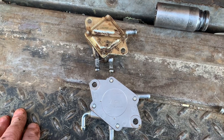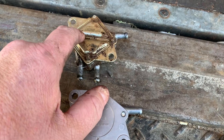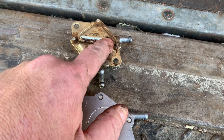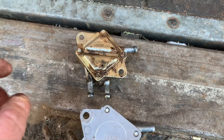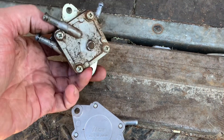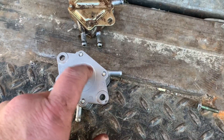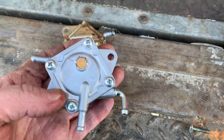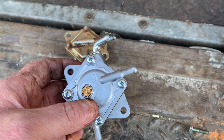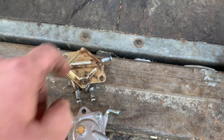That should not be a problem — you should have enough room to reroute your fuel lines if needed. The reason I'm replacing this fuel pump is because the discharge chamber weep hole is spitting fuel, which means the diaphragm has failed. We'll go ahead and open this one up just to see the failure. I kind of wished I'd have waited because this would have been awesome, so let's tear this one down as well.